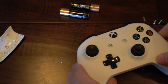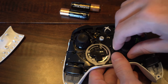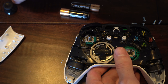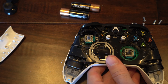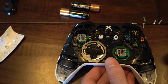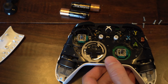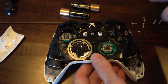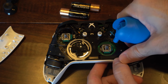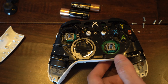Now what we want to do is remove these covers. At this point you can remove the thumbsticks as well. Depending on which one you're going to be cleaning out, you can also clean it up from here. I've got some rubbing alcohol and a Q-tip. I could try cleaning it up without completely disassembling it, and then you can take your compressed air, spray into here, and just clean that up in case there's anything going on.